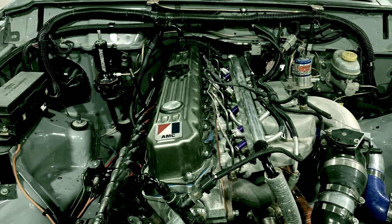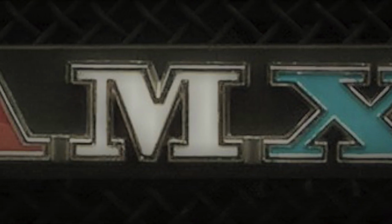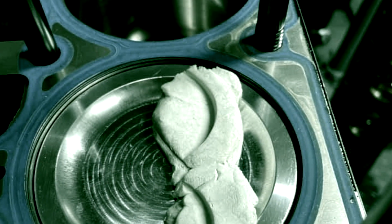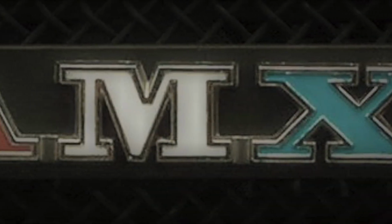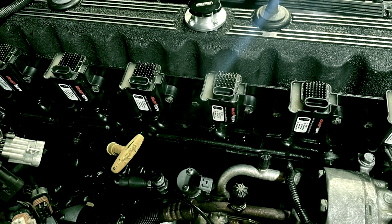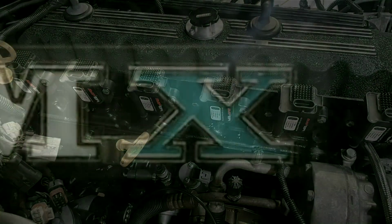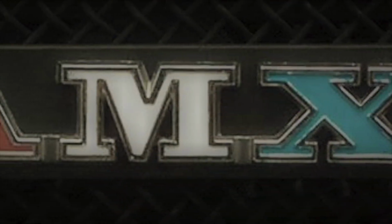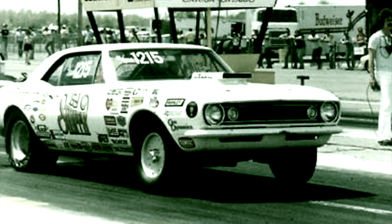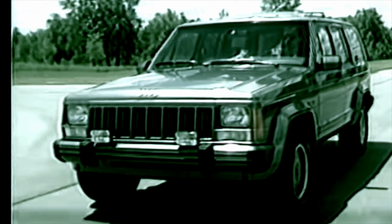I said, the problem is these caps are moving fore and aft. And the more power you make, the more it's going to move. In the NVH lab, they put some accelerometers on some of this, and you can see. Hang on a second, there was actually an NVH lab? Yeah, they were always doing all kinds of testing. The NVH guys went to engineering and said, we did some accelerometer tests, and we noticed that the block is moving fore and aft. And they said, well, enough to be concerned about. He says, are you seeing any wear in the bearings and stuff? And they had been seeing wear in the main bearings.